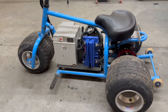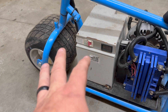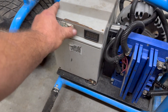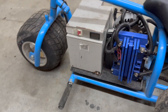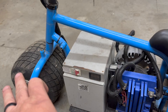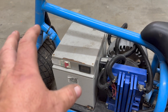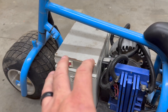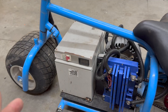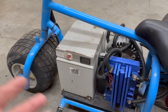The bad thing is the battery — I have completely let it go. I haven't charged it, and I didn't cut it off when I was supposed to, so I kind of neglected it. I'm going to try to open the top of the case and apply some voltage in certain places to get it to take a charge again, because I believe the BMS is going to sleep.